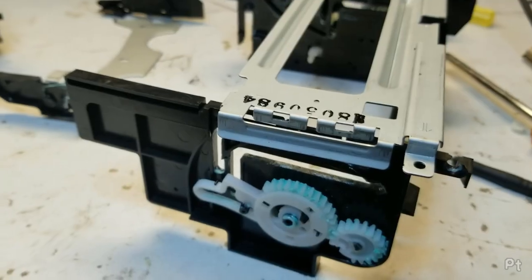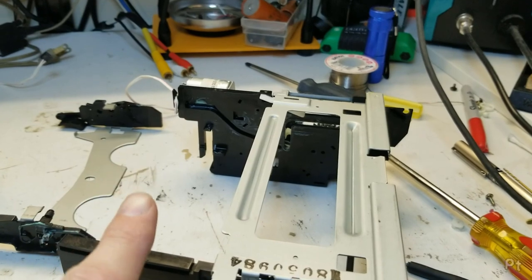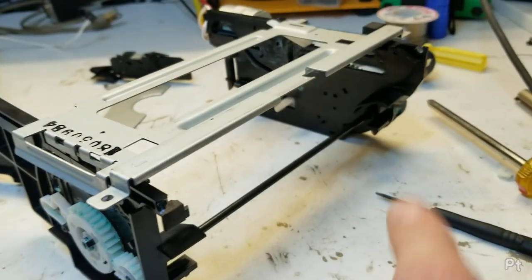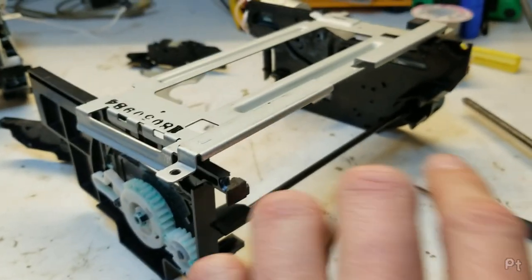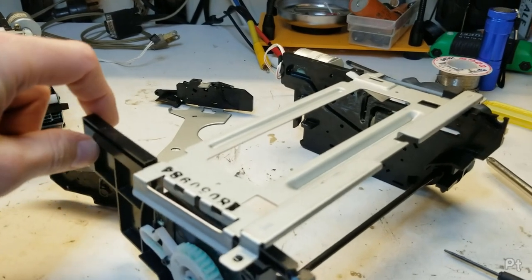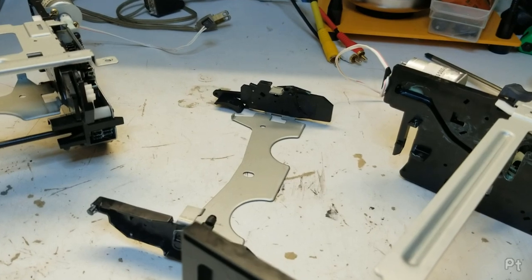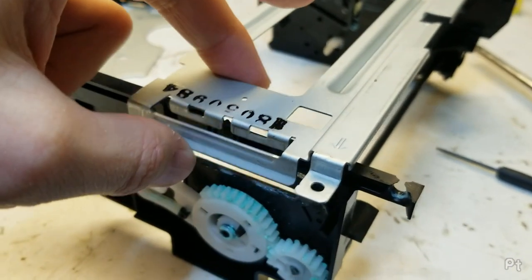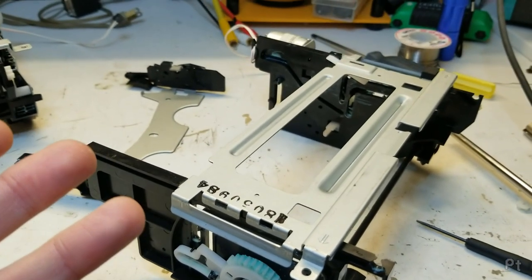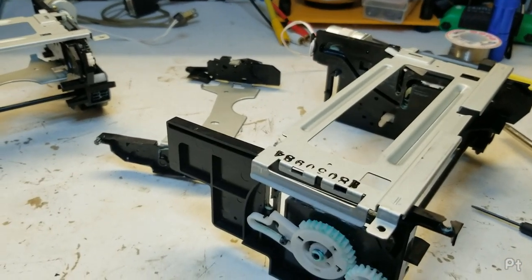If anyone's ever doing this and taking these apart, I highly recommend you move the tray into the loaded position. Because you have this bar that is press fit into gears on either side — this side is held fairly firm, but as you move in you can move these side pieces out just enough to take the loading tray out. Then popping this off — the plastic is precarious. This is all 30-plus year old plastic, so you're risking it every time you do anything with it.